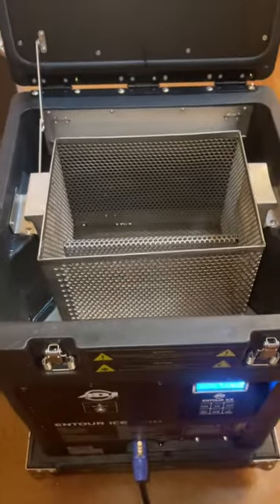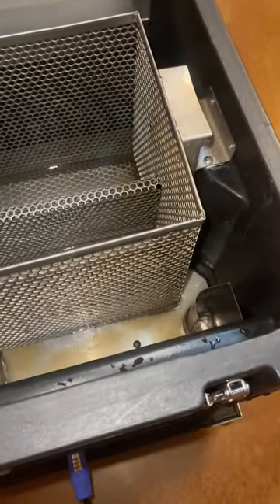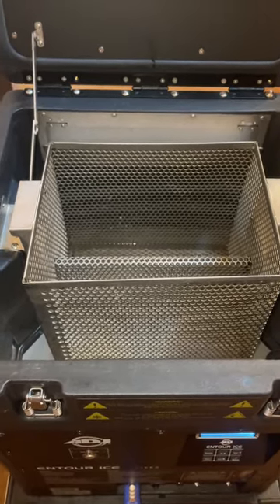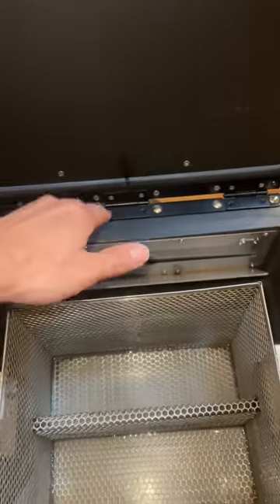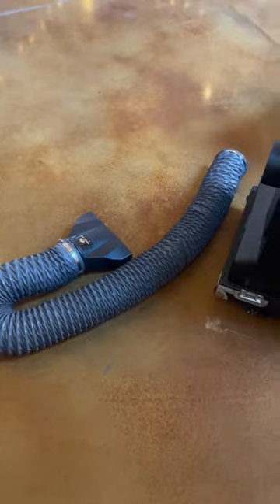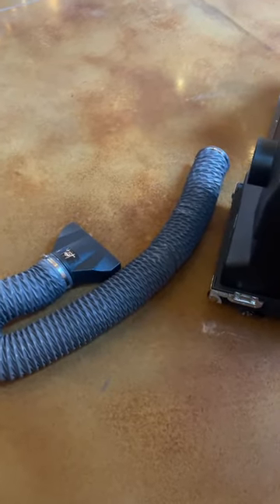Simple operation if you're using it manually. The water will automatically drain back into the reservoir to continue to heat, but just let it run throughout the duration you want. It will take a little bit to build up pressure with this rubber gasket and force the smoke out of this flap to spill out through the front. I recommend using the hose — it brings the fog down to ground level. It's a standard dryer hose with a gasket and a wingnut tightener. Gently guide it all the way flush onto the unit.